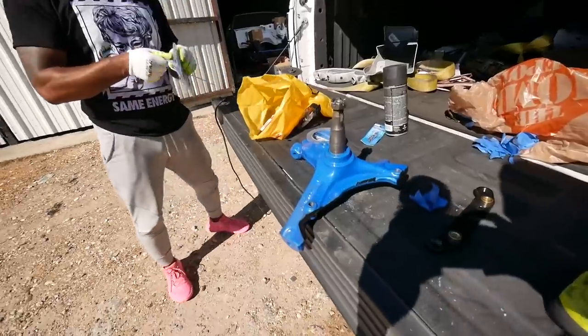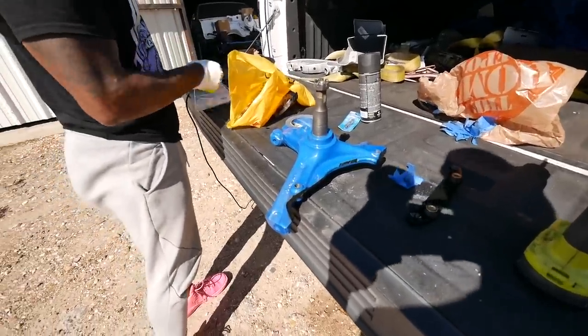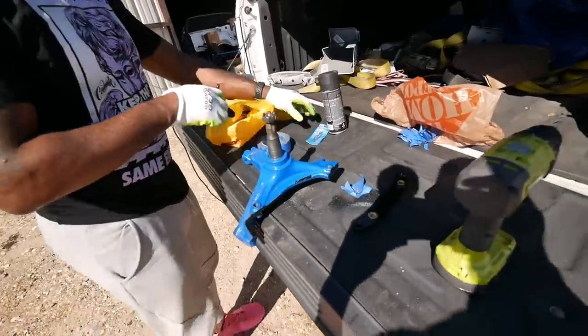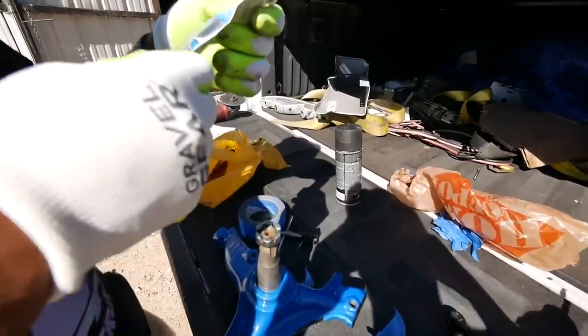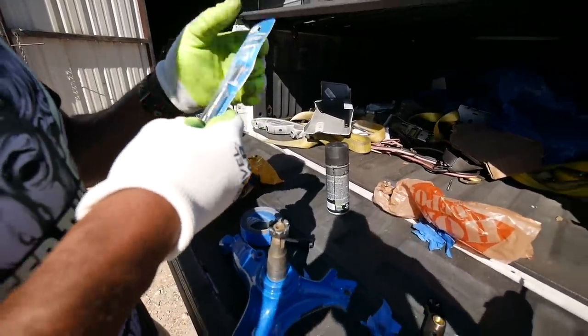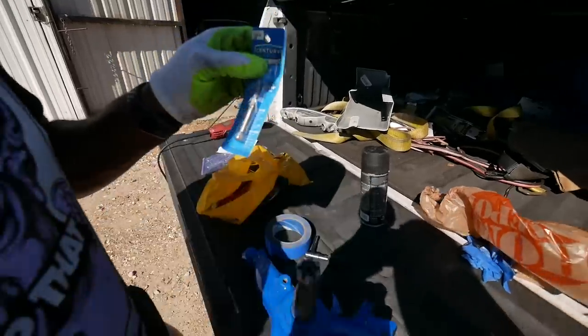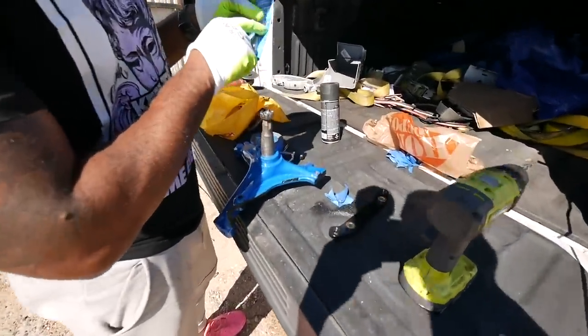This one. I had no scissors, bro. I got a bus cut in my car. So I'm trying to get it up. Yeah, we see. All right, guys. So, this is the... Bro, is this the right one? Hell nah. Oh, 3/8, yeah. 3/8, 24. And then 21/64, that's the drill bit I actually use. So, that's how you know if it's the right drill bit.